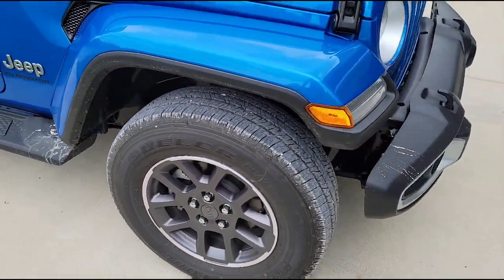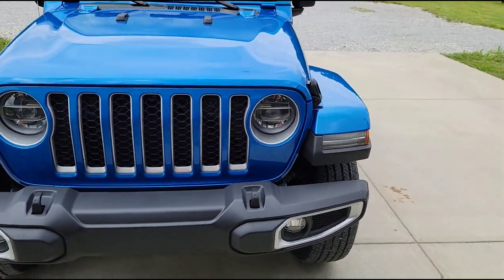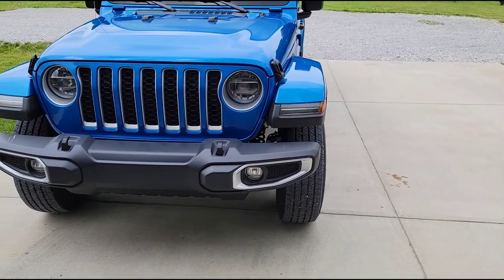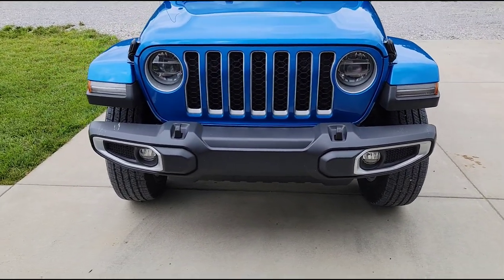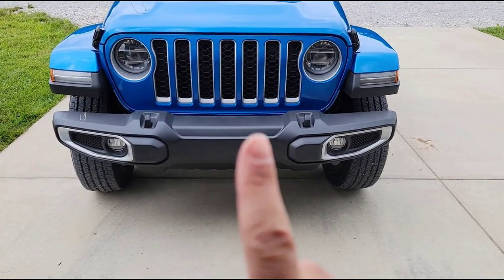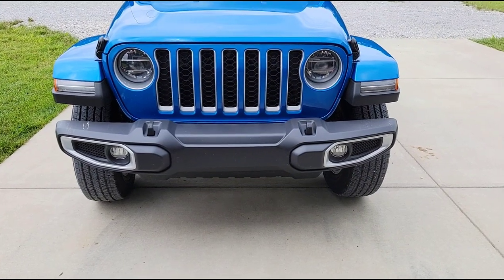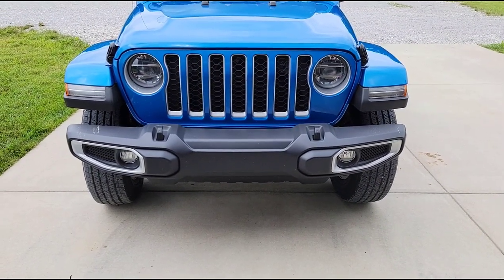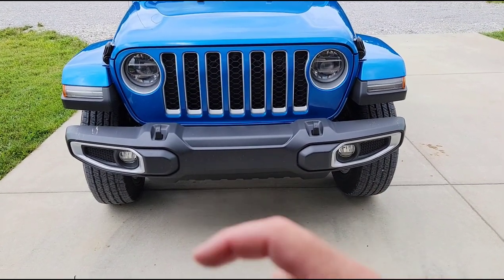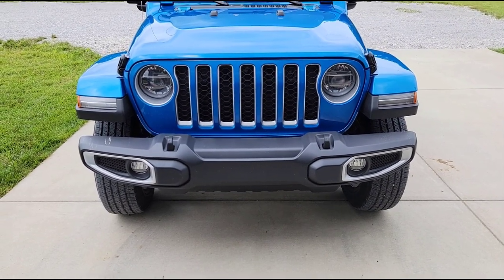The reason that's interesting is because — and I'm parked here in my driveway because that's the only place I know is nice and flat and even — what that shows is that from the factory, the center line of the front axle is moved over toward the driver's side just a little bit. You would have to take the front axle and move it toward the passenger side one quarter of an inch to perfectly center it up.